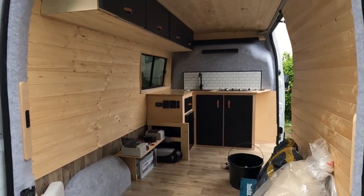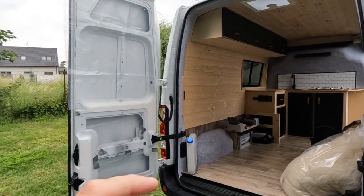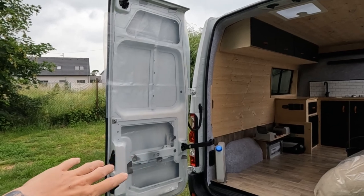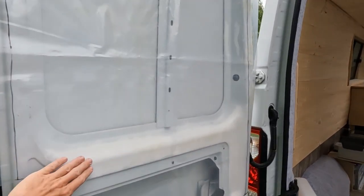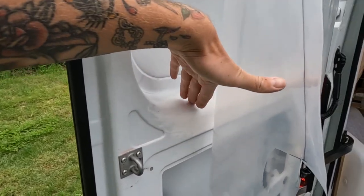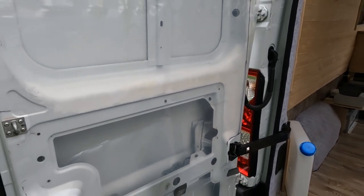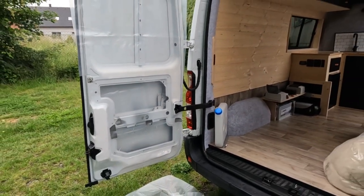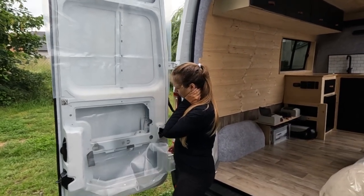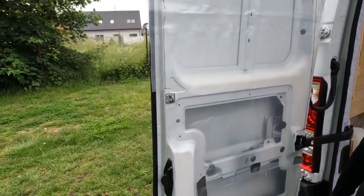This is how we're looking. These are the horrible back doors that we've got to deal with. They actually had some panels on them when we bought the van — a panel on the top, in the centre, and in the middle separately. But because it's all scratched where the metal is visible, someone's tried to paint it with a brush using random paint and it doesn't look very great. So the plan is to try and clad the whole thing in a sheet of 4mm ply that will match something similar to the pine cladding we've got in there, and the grey carpet we're using to cover all the trims will go on some sections here to cover different bits.